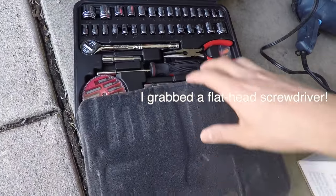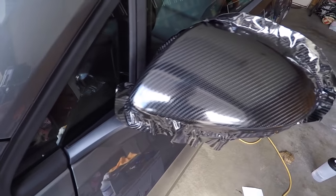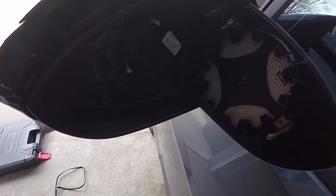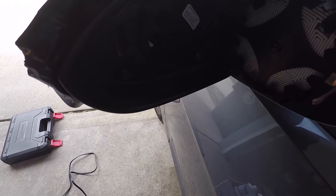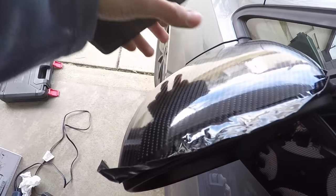The main part of the wrap is pretty much done and I've got the edges down pretty well. Now I'm going to remove the whole cap. It's going to be different for every car but the overall process will be pretty similar. I just figured out a way to snap this mirror off — it took me a while because I was very cautious and didn't want to break anything. For this car there's a clip right up there and another one right back there, so I'm just going to release those clips and the whole thing should come out.